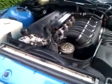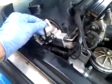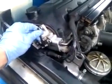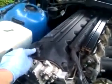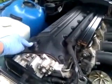When you remove the valve, this is the amount of oil you lose — there'll be a little bit more, maybe about another third I wasn't able to catch, so that oil will have to be replaced. Don't forget to oil the O-ring seal before you put it in. After refitting the valve, I removed the Vanos filter using a 4.5mm Allen key, filled the Vanos with engine oil so it was overflowing, wiped off the excess, and put the Vanos filter back in. I got about a quarter of a litre of oil in the filler cap and ran the engine at idle speed for about 2 or 3 minutes, then switched it off and allowed the oil to drain.